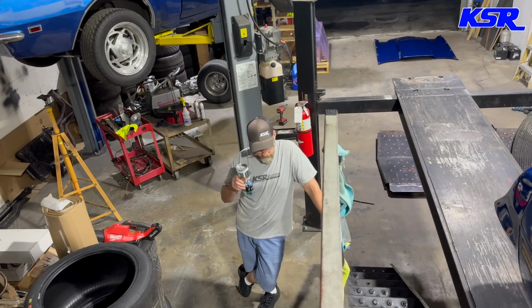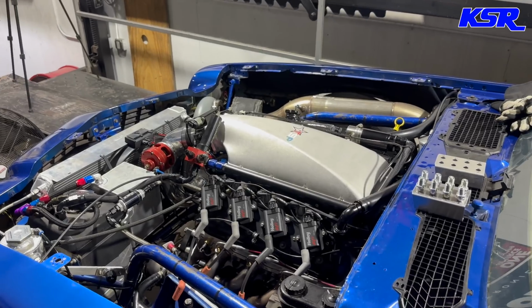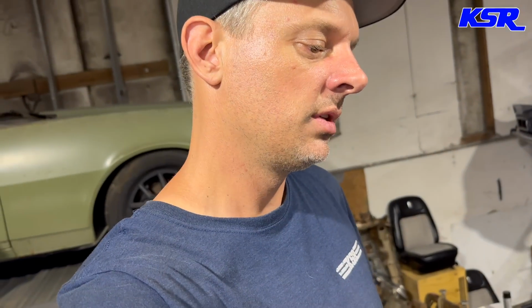Yeah. Still got oil in it, still got water in it. Woohoo! Not pulling anything apart. So yay. At least not yet. I think we'll retorque the heads, or at least the bolts we can get to easy. Maybe not the ones under the intake manifold. Even if we have to pull the rocker shafts off of it. Although you do have to pull the headers off to torque all the bottom ones. That might not be fun.